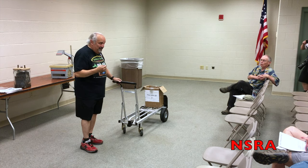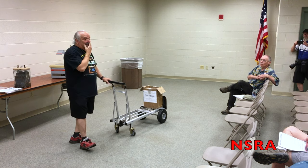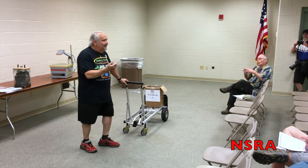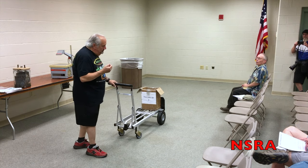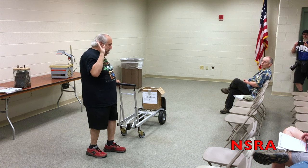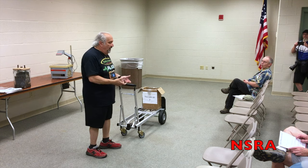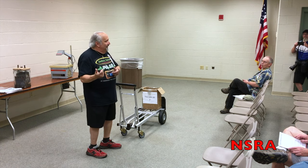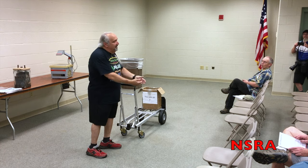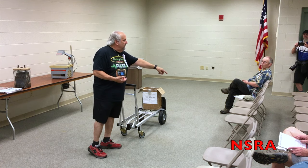You blow up a battery if you try to reverse the polarity on it, or if you ever plug your battery backwards when you're jumping, you know what I'm talking about. You're hoping for no explosion. And I'll bring you into the last little thing about explosions. I have been lucky enough to never have had an explosion myself, because sometimes when I wouldn't pay attention, I'd jump cars where you connect to the other car first. You should always connect your jumper cables to the car you're jumping, and then go over to the car you're jumping from, so we don't get sparks at that battery.